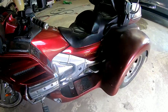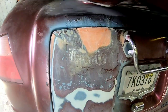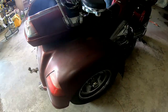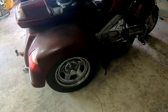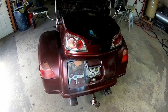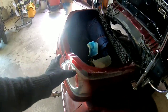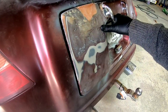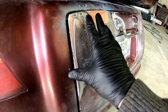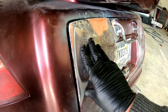So let's take a better look at this Honda Goldwing Trike. As you can see, the paint is faded on this lower tub and the luggage rack. The rear compartment door has been severely damaged — it got locked on the owner and he had to break into it, so we're going to repair that. Down on the front part of this lower tub, there's a section of fiberglass missing. We're going to repair that, replace it, and get this thing ready for paint. The first thing I'm going to do is start to disassemble it. We're going to leave the lower tub together but remove all the taillights and this top portion of the luggage compartment, but the main thing is this luggage compartment door — it doesn't fit quite right. He started to do some repairs on his own and it's not level with the rest of the panel, and there's some fiberglass repair that needs to be done where that last latch assembly is. So let's dig in and get this disassembled.